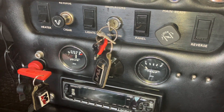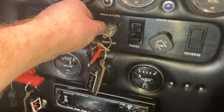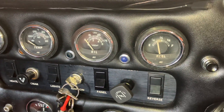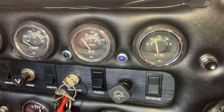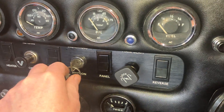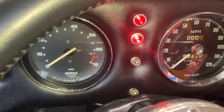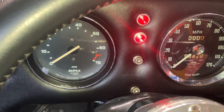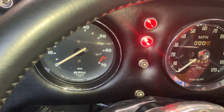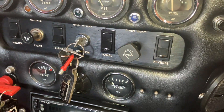That separate circuit covers the interior light and also the alarm circuit if one is fitted. Now we have the ignition barrel — this has a two-position setting for turning things on without the ignition circuit. You'll see the fuel gauge lights up and comes on. Back to the center, we turn the switch to the center position and you'll see the telltales come on for the oil pressure and for the ignition warning circuit. That's ignition on.